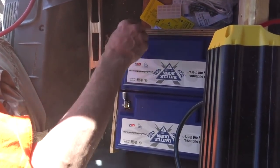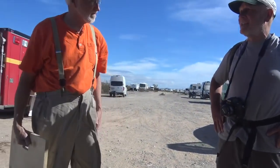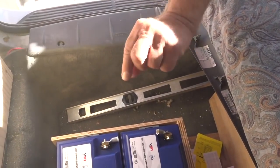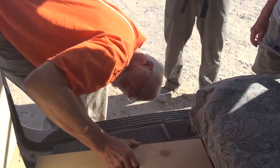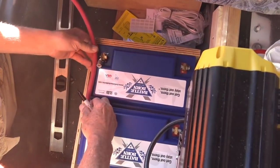You might hit the lid the other way. I don't think it's going to hit the lid, but we can find out right now. Have you ever taken into consideration the condensation loop — where if the cable is above a connection, condensation can form and drip down? I'm really not worried about that in a battery that's waterproof. What I'm worried about is clearing this. There's plenty of clearance for that — no problem. I'm going to go over the top. Since these distances are the same, I'm just going to measure how long the cable needs to be.